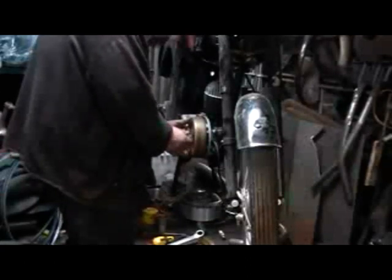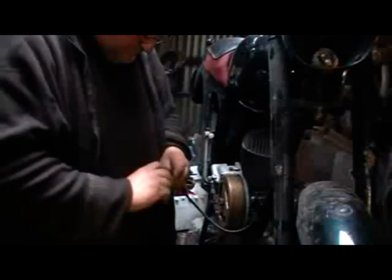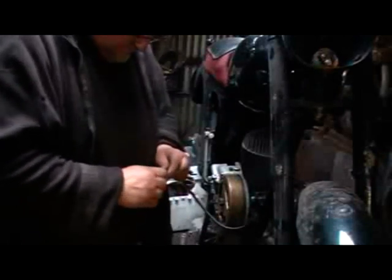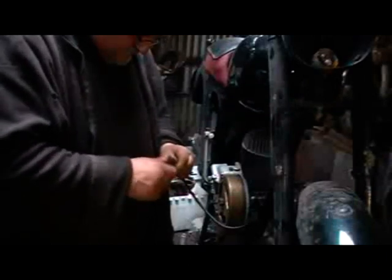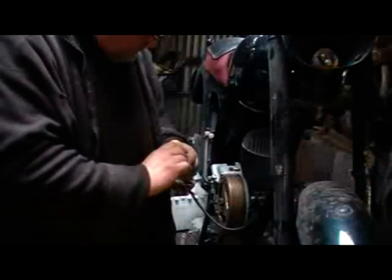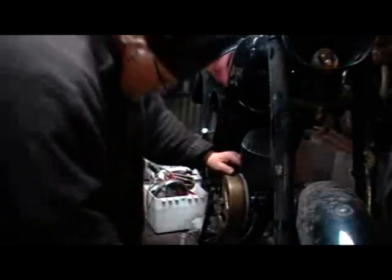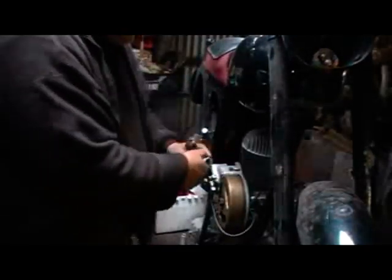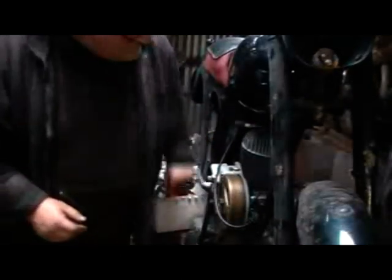There's an arrow on the brass flywheel that lines up with a notch on the back plate. Then it's a simple case of screwing it together, tightening it up, turning it over — and there you have it: a nice big fat spark! The HT lead was a bit long so I trimmed it and fitted a new plug cap, just removing any chance of problems. It's the Lodge type that just screws into the lead — I find them very good. Then just put the old plug in, make sure everything's okay, and yes, we have a spark there as well.